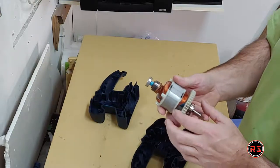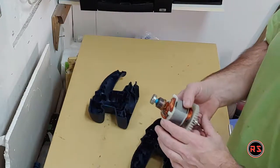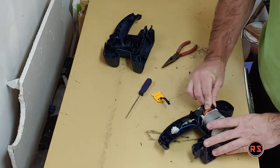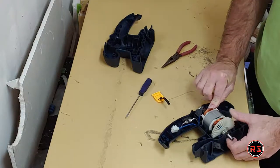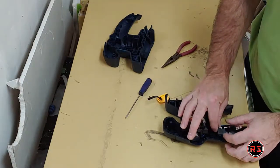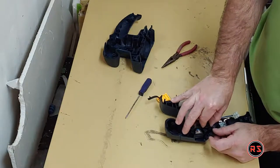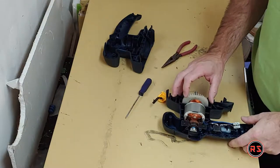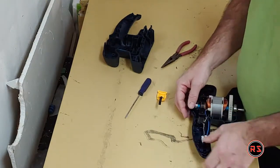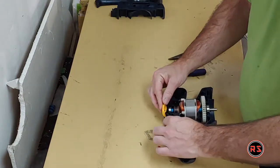For the copper wires and the motor itself, I haven't put any water on it in case I create a short — I just blew it with compressed air. The switch is loose now, so let's put the other brush in. It's pretty easy to put the brush back in — it's not always the case. The switch is back in its position as well.